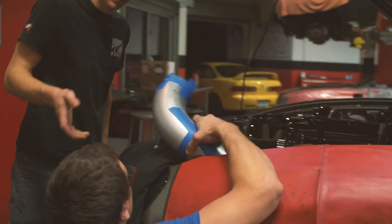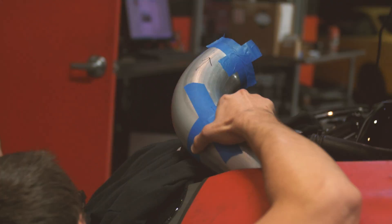With that, I had to redo a lot of the charge piping from the intercooler to the throttle body. The drive-by-wire doesn't provide any significant power gains, but it does improve drivability and idle. And AEM Infinity does a great job of controlling it.